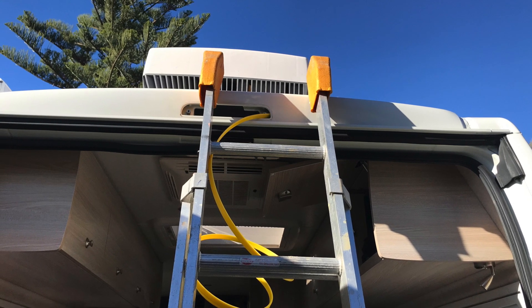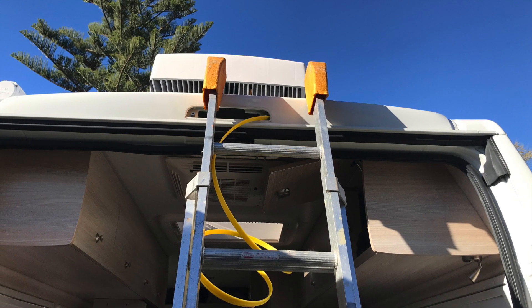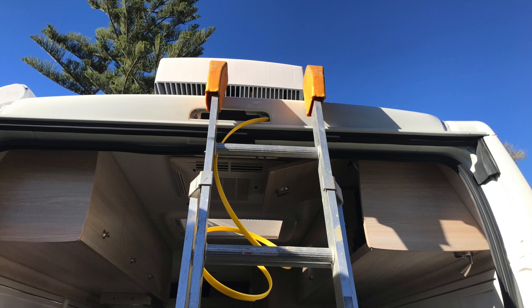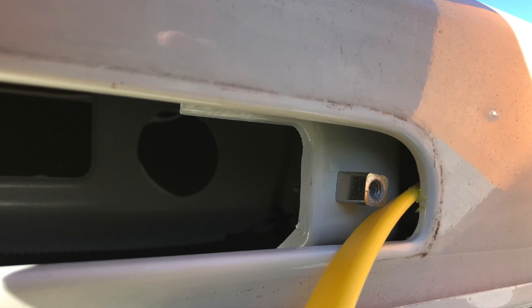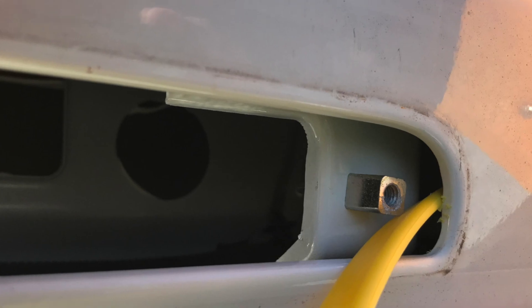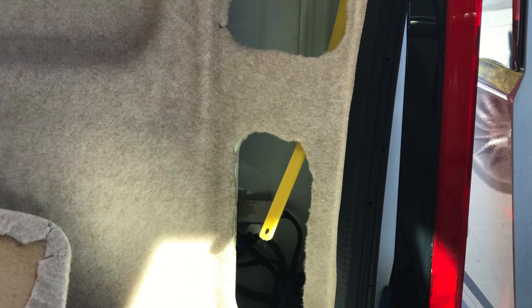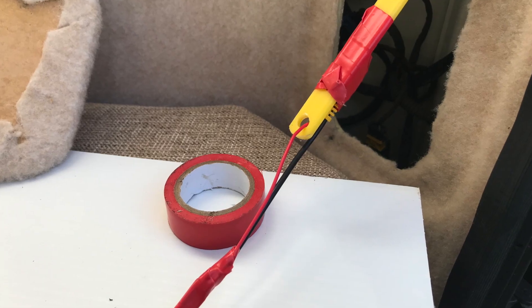To find a channel I used a flexible electrician's tool — basically it's a method of jamming it down until you find the right spot, and it snakes down the side and pops through the other end. Then you pull it out, and using some electrical tape I connected the video cable to the plastic flexible piece and pulled it out carefully up to the top.